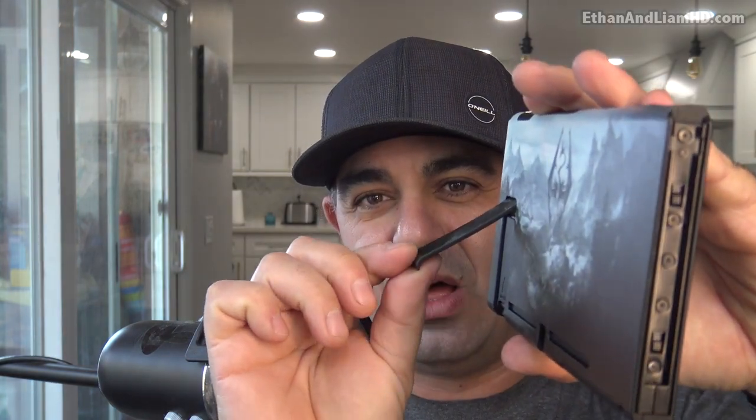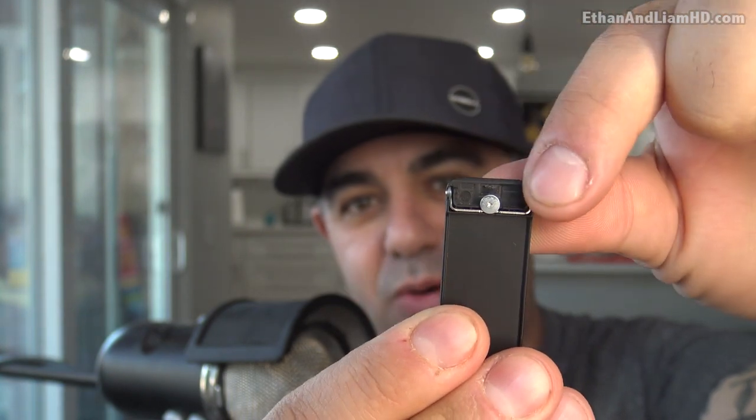Ours is still loose. It did fix a friend's - I just tried this on a friend's Switch and it worked beautifully. So it may or may not work for you. Now we're gonna use our handy dandy screwdriver. We're gonna first need to remove this guy, then simply go up and over and it's gonna pop off - it's intended to do that so it doesn't break, which is why it popped off in the first place. We're gonna fix that by bending these little prongs right here.